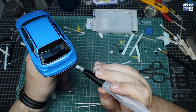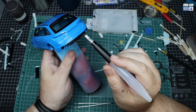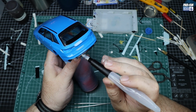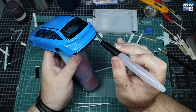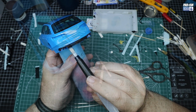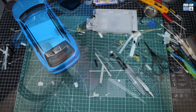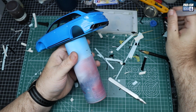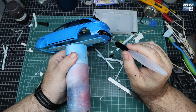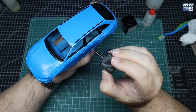And then we can get another piece of carbon, cut it roughly to size, line up the weave, get it in place, patch it up. As long as you line the weave up, it is almost unnoticeable on parts like this. You have to look really close to see that it's been pieced because it does conform really nicely together. Just a little moment there to admire that spoiler, just how nice that looks. And the roof rails, looking absolutely beautiful. Very happy with that job. Like I say, a good, I don't know, 12 to 18 pieces of carbon under here for this piece. Just pieced it and pieced it and pieced it until we were happy.